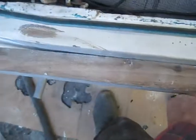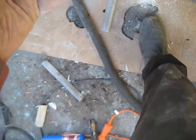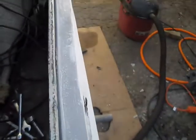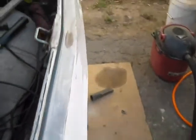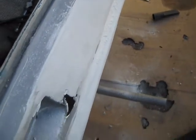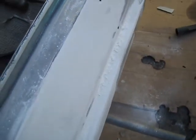Looks like here at the tail light, hold it flat right at the center. Start to come out like 1/4 of an inch. Hold this at the tail light straight, and looks like we're almost the same distance. Might have a little high spot right there, but basically I got a nice curve in it. Curve looks good from this side, about the same. Looks good across the bottom. Looks like I might need a little fill right in there.